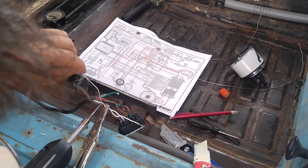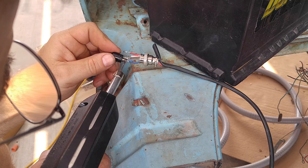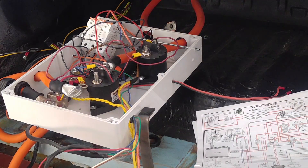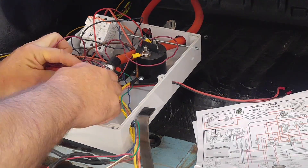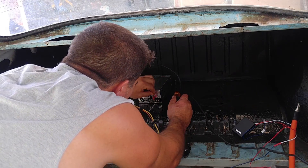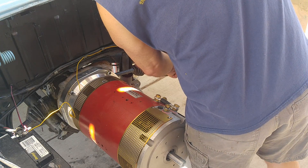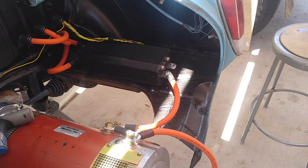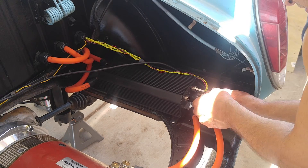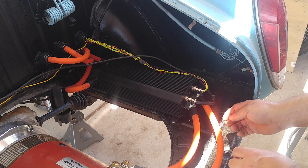Soldering all the wires into the connector for the Prius throttle, and onto the end that connects to the controller. Next it's time to assemble all the wiring into that box I constructed earlier. Really important to clean all the contacts well and apply a copper paste to have a better connection. Wiring in the DC-to-DC converter and finally the charger. Installing the controller — it's a Ziva MC1000 1000-amp controller. Hooking up the cables. Installing the wiring that links the controller to the core and the core to the monitor. Communication between components is done by a 4-wire CAN bus interface — fairly universal.